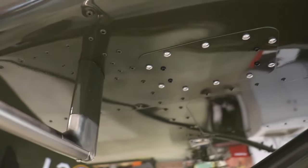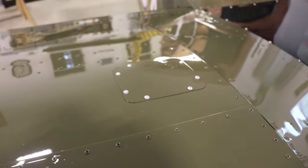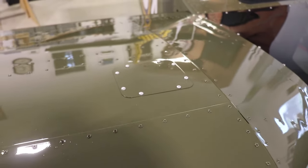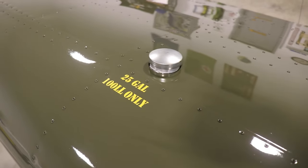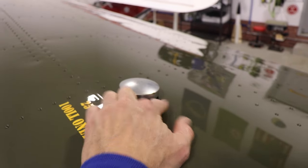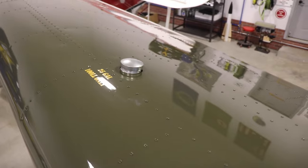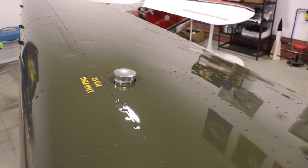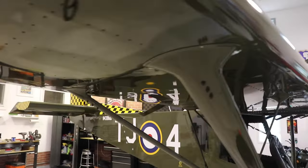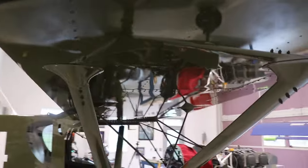To give you an idea of how lazy I've become, you can see that these screws are nice and polished, but these screws on top of the wing I didn't bother polishing because nobody can see them. I have my fuel cap labeled there, and we are making a fairing that goes behind it to clean up the drag from that fuel cap. That's one of the things that will be available on kitplaneenthusiast.com pretty soon. And speaking of fairings, on the right wing here you can see just how beautiful these fairings look.